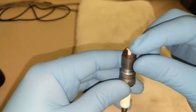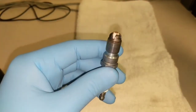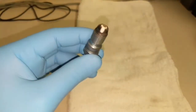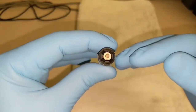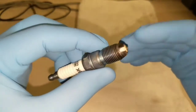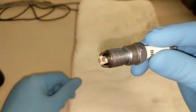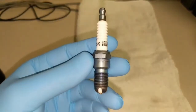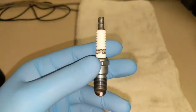There's not much carbon build-up on it. I just hit them with some electrical cleaner on my spark plugs just to clean them up — they were not that dirty. We were doing some tuning and there were a few instances where the car was a little rich, so I just wanted to pull the plugs out and see how they were doing. But they're doing great.